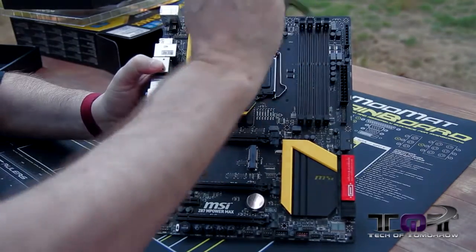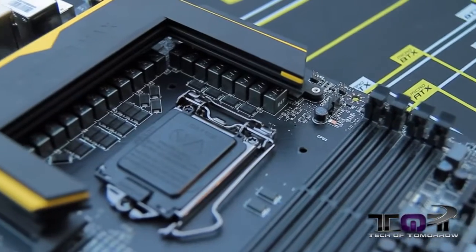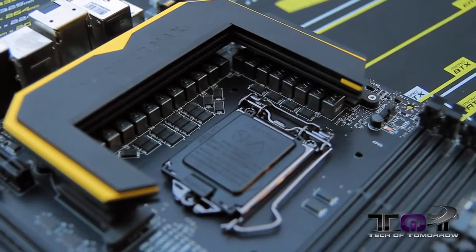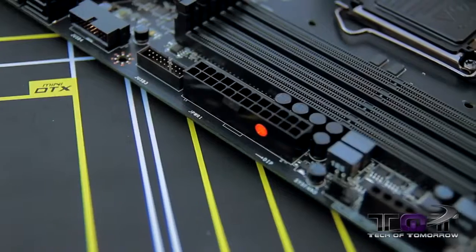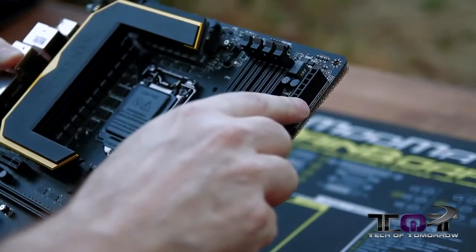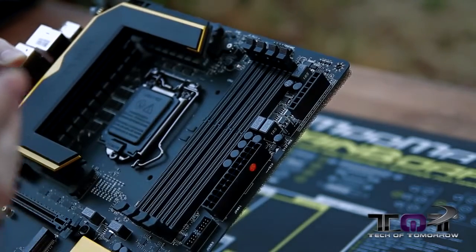We're going to work our way around and see the first of our fans — all these fans can be controlled through the BIOS as well. Let's take a look around the ZIF socket area. This is the LGA 1150 for the new fourth-generation Haswell chips. You guys can see all the MOSFETs are covered all the way around. Underneath, you can see all of the quality chokes and components being used — very, very expensive high-end components. We're going to spin around and go to the side of the board. We see we have four DIMM slots for memory — this motherboard can support up to 32 gigabytes of DDR3 memory. We have a bunch of little ports for connecting up a meter to measure all your power on the board — those little wires from the unboxing hook up into this area, then into your meter.